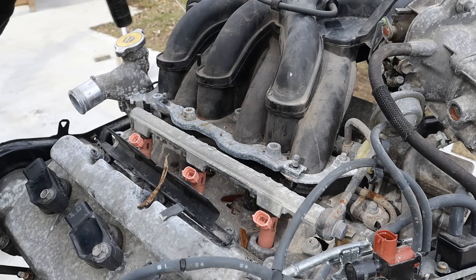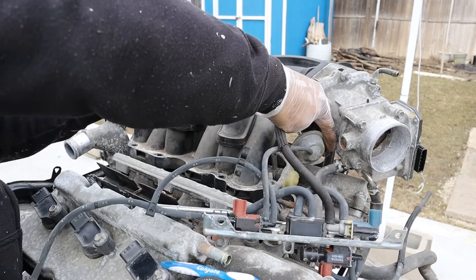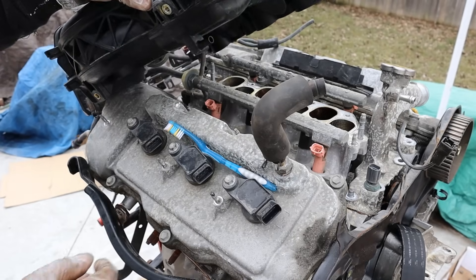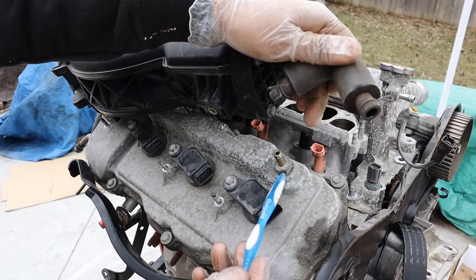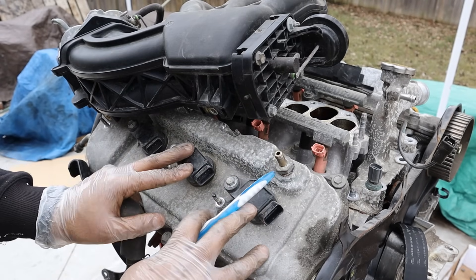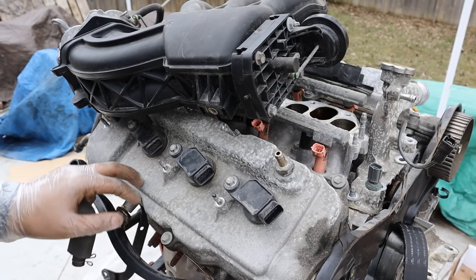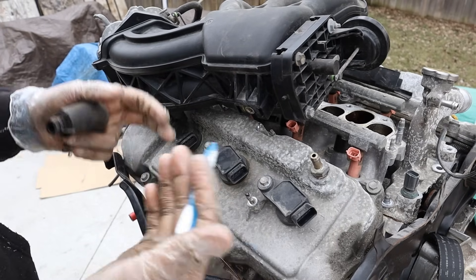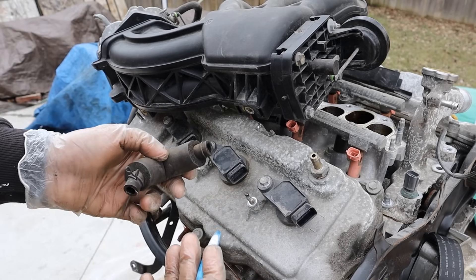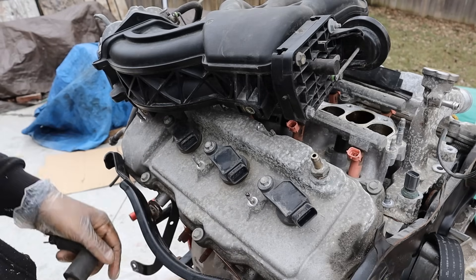Next we're tackling the intake manifold bolts. Now let's talk about the PCV system. This PCV valve has a tube that brings vapors from the crankcase and sends them to the intake to be re-burned. This is a huge issue because older versions of these engines — like in the 4th generation Toyota Camry, ES300s, older Siennas and Highlanders — caused major oil sludging. These engines would consume a crazy amount of oil or starve themselves from lack of oil circulation. The PCV system and valve cover were not designed for really long oil intervals, so if you stretched out your oil changes, it could clog the system and engine sludge would start to form. In the 5th generation Camry like this one, the valve cover and PCV systems were redesigned for better circulation, and these engines are thus not subjected to engine sludging.